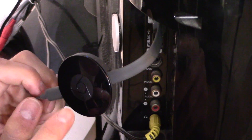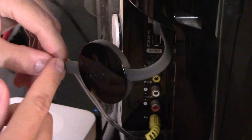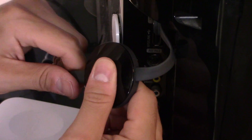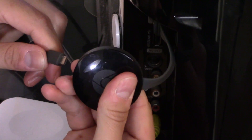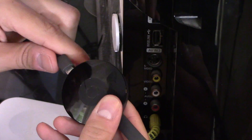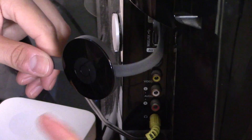I made a separate video on how to do that. Now if your Chromecast is connected to an AC outlet with the correct power adapter, go ahead and unplug it, wait 30 seconds, and then plug it back in — just like this. And it should work properly.